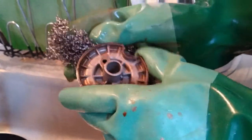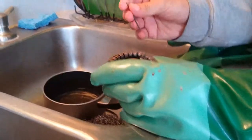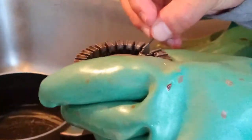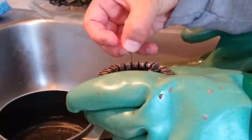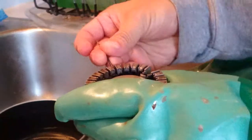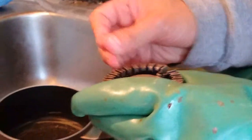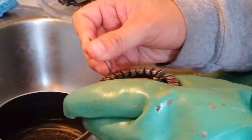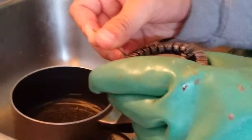Try to clear up all the airways for the gas to go through. I'm using a little drill bit to go into all these creases and go all around — this is where all the gas and fire comes through. Go all around a couple of times, clear up as much of the gunk as you can, and clear the way for the gas to come through.